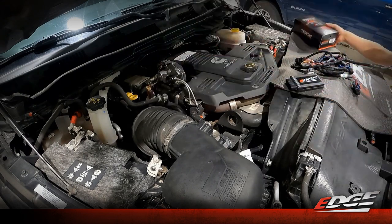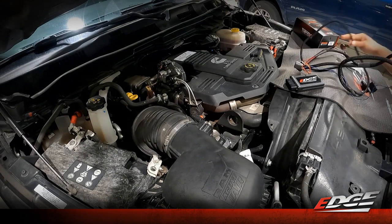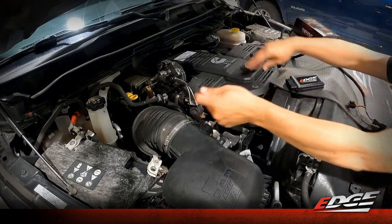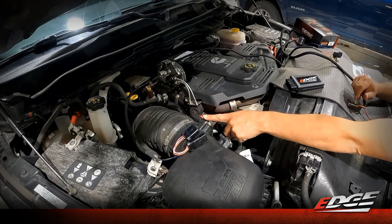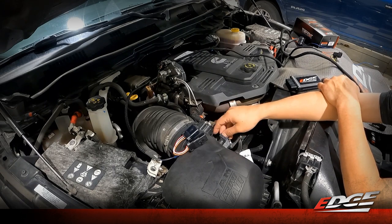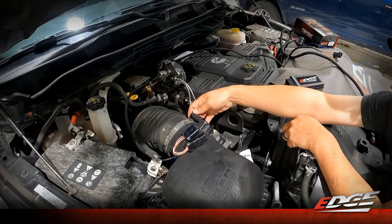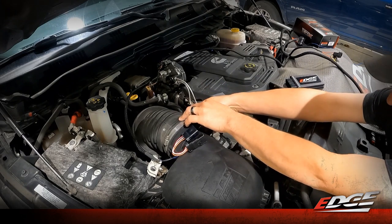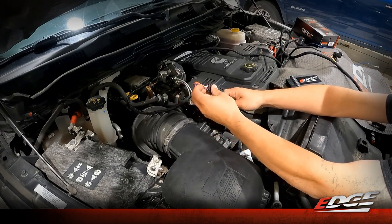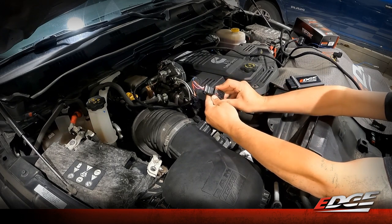Get this out of the way so we can get to our mass airflow sensor. The harness has a few connections to make under the hood. We'll start on the passenger side with the longest section of the harness, which comes across the firewall to the mass airflow sensor on the factory air box. There are two sensors on the air box — use the one furthest back, closest to the cab. Press the red retainer clip up to disengage it, press the back side to unclick the safety latch, then disconnect the factory sensor. The new harness plugs right into those factory connectors. You'll hear it click, then close the safety latch.